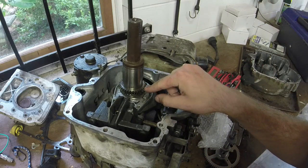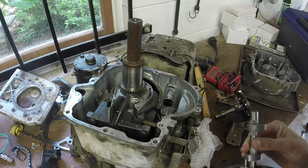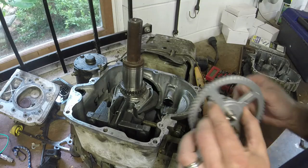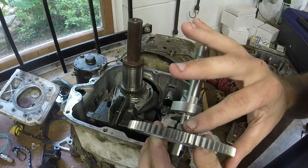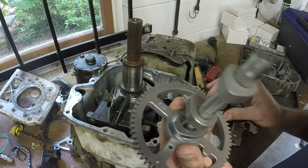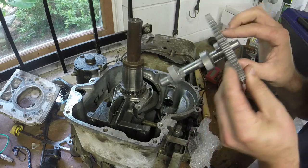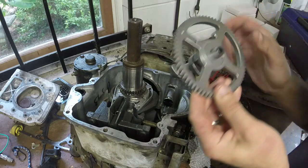Next thing you're gonna find, you're gonna rotate this. There's a dot on this cam gear, or a crankshaft gear, excuse me. And we're gonna put this camshaft in. This is one of those Amazon camshafts. I looked and found the one that was a little bit better rated and spent a couple bucks more, just hopefully to have a better experience.